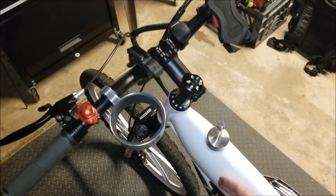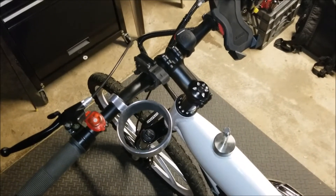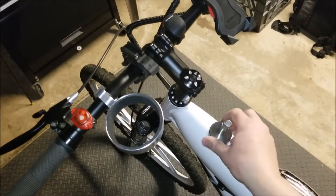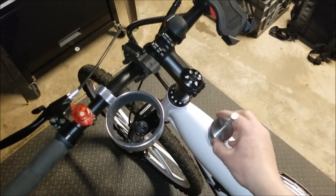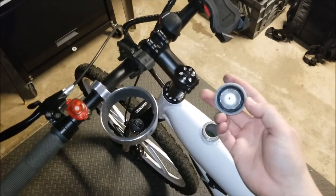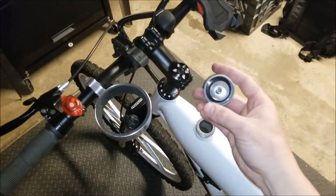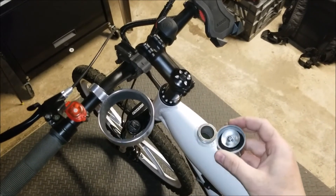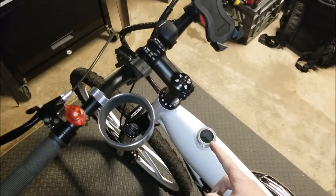Something of my own creation to keep fuel from leaking outside of the cap — which I'm sure many of you are very familiar with, the leaking factor — is I went and got some eighth-inch thick nitrile rubber, cut that to size and the right diameter, and put that into the cap to keep it from leaking. I also went an extra step and made a parabolic splash guard, and there is airflow that goes all the way through. This is the exact diameter of the hole so fuel is not splashing out.